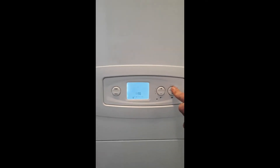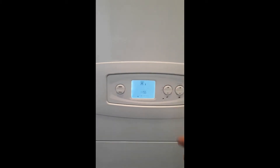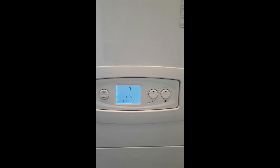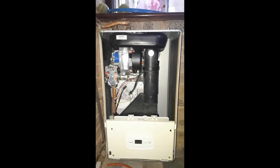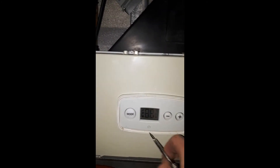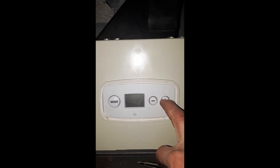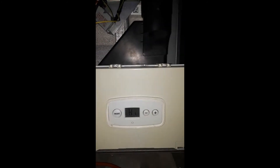To do that, hold down the plus key and that will take you to the original screen, then hold down the reset and start again. Or you can hold down the reset when you're in that function mode — whether it's minimum or maximum — then push the plus key again and hold that down, and you'll get back into service mode. To come out of it, you can either push the reset or hold down the plus key.